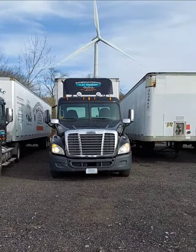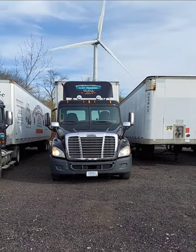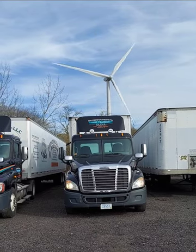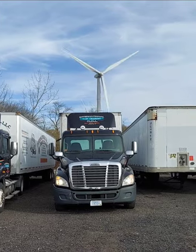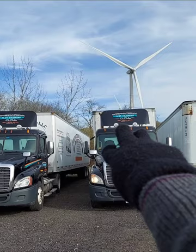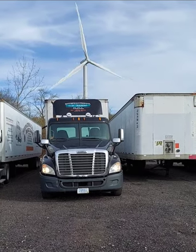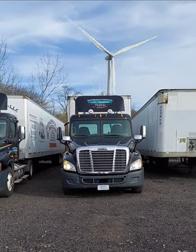General overview. My truck is not leaning left or right, which will indicate a suspension problem or a flat tire. My cab clearance lights are clean, no crack operation. My cab marker light, two lights over there — it's clear, not crack operation. My cab ID light, my three lights over in the middle, is operational, indicating the trailer or the truck is 80 inch or wider. My windshield is secure with a valid expiration sticker.